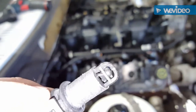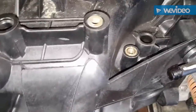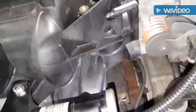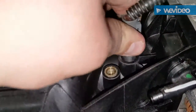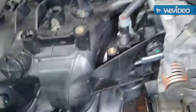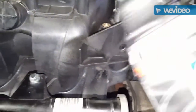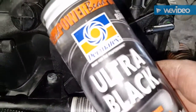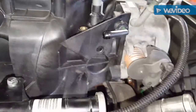At this point I pulled the evap sensor out — it goes right there. Then I'll test fit it, put it down in there. Yeah, it seems like it'll go — it's just snug, and I kind of want it snug. I'll tap it in halfway and then put some Ultra Black RTV around the top and then send it home with a hammer.